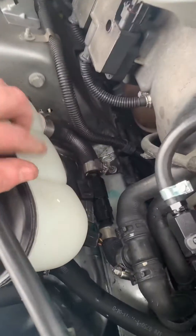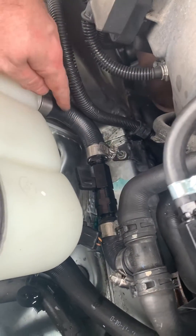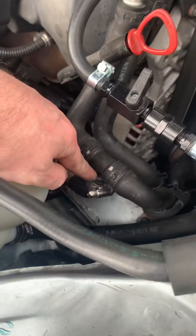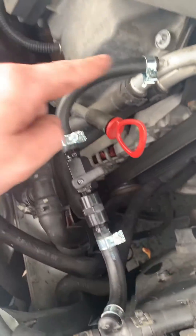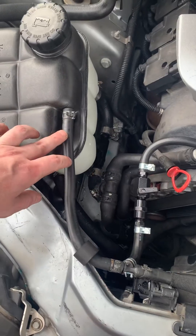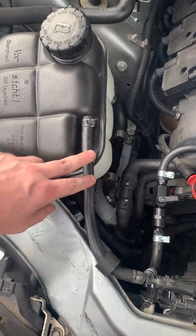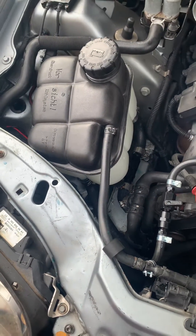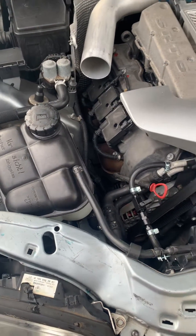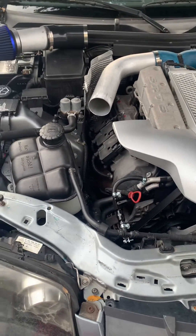As far as the installation of the isolation kit, it's this back hose here. It goes into this T-fitting, and then this front hose here goes into the motor. While I was at it, I installed the longer return line hose as well — hopefully it'll help it last a little longer. Seems to fit a little bit better. Pretty straightforward installation. I'm looking forward to the results.